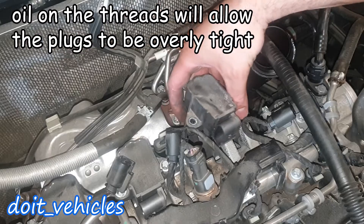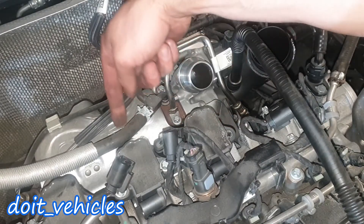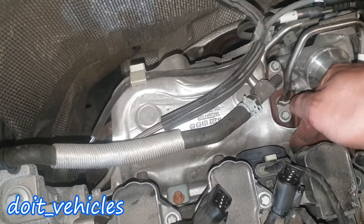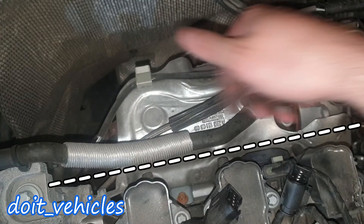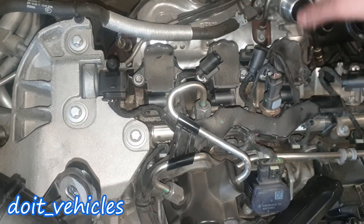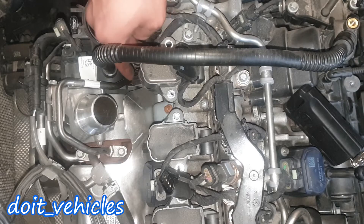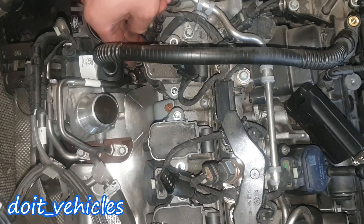Let's press this on the plug. Make sure it's aligned with the other two — that's one of the reasons I didn't remove all of them at the same time. For example, this one is gonna be aligned with this one and with that one. In that way you know that the coil pack is all the way on the spark plug. It should match these holes here easy. If the coil pack is not aligned, you need to press it more until it looks aligned.